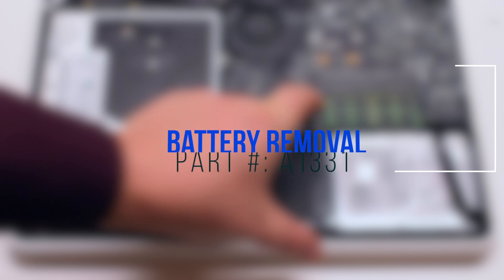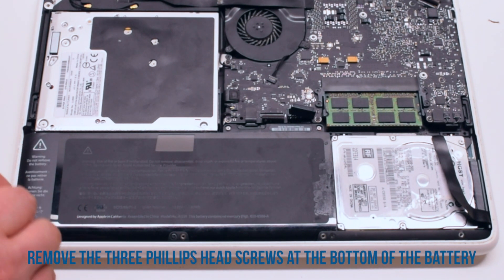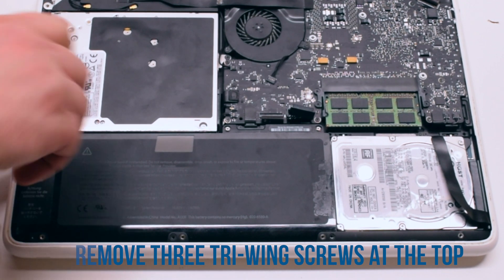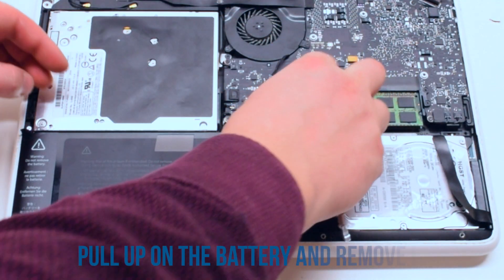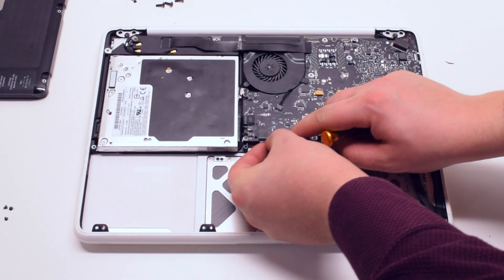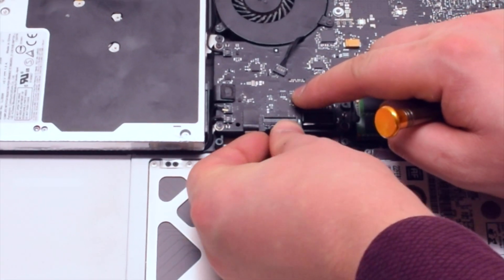We have to remove the battery to reconnect the keyboard. Battery removal: start off by removing the three Phillips head screws at the bottom of the battery. Now remove the three tri-wing screws at the top — the one on the far left is hidden behind a piece of tape. Pull up on the battery and remove it. Now that the battery has been removed, we can reconnect the keyboard. This is a difficult task and might take some practice. Make sure that the eyelash is lifted up before you attempt tucking in the keyboard. Once tucked in, press down on the eyelash.